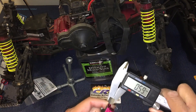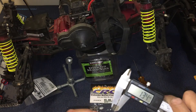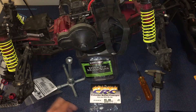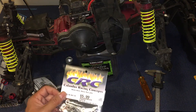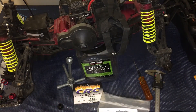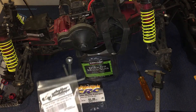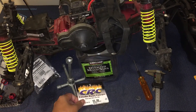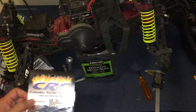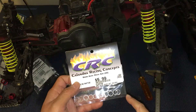I looked this up online on the forums and other folks suggested putting some shims in there. If you buy the official kit from Losi — I forgot the exact part number — it ends up being around $20–$30, versus the $6 I paid for these. A pretty big price difference. The official kit does come with some shims. Folks on the forums suggested 8mm internal diameter by 10mm outside diameter shims, 0.2mm thick, to take up that play.